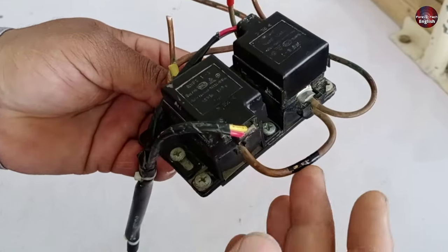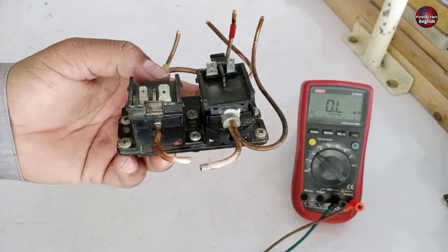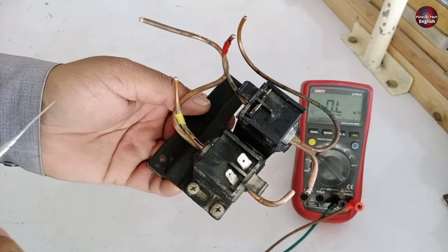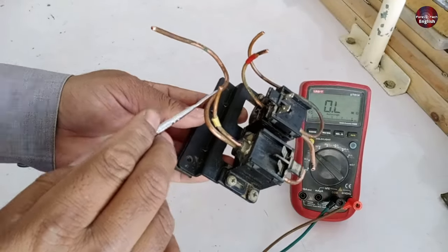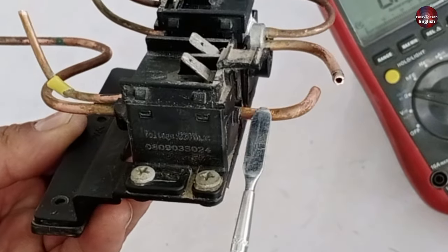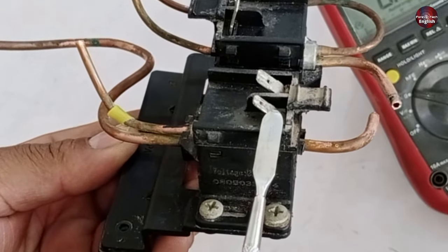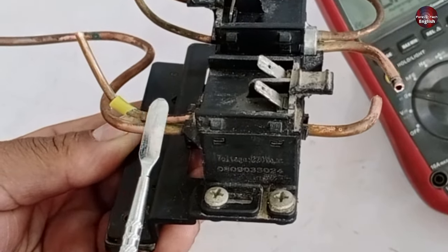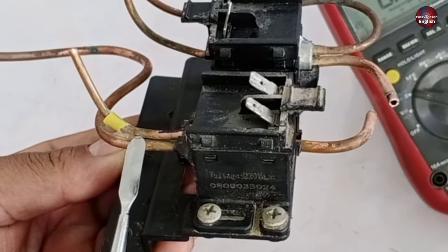This tells us what the human mind is capable of. I have now separated the pipes from one another and opened the cover of the valves from the top. Samsung has manufactured these E-magnetic valves differently from each other. This is the main pipe gas supply — it goes inside the valve and is directly attached to the main pipe. When electricity passes to the valve, it turns on, this pipe stays attached, and the gas flow passes through the yellow pipe. The yellow pipe will pass no gas if no electricity is supplied.